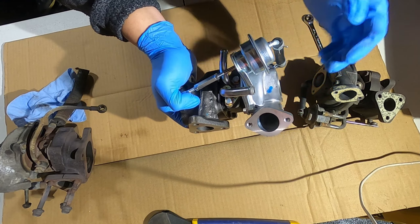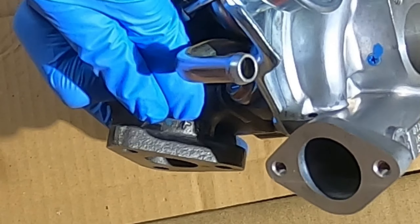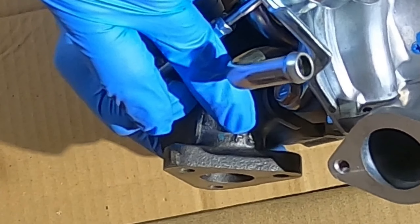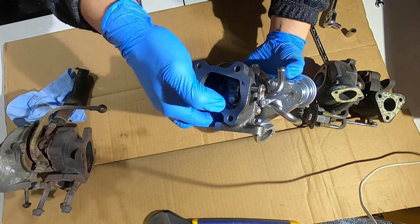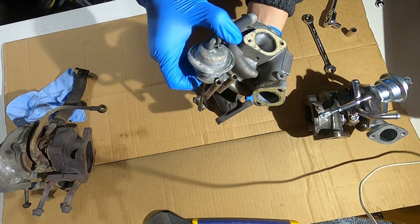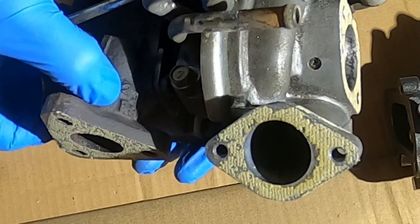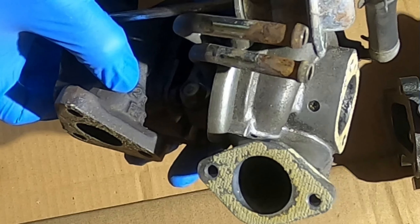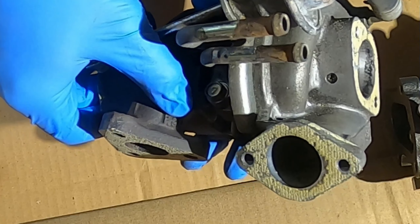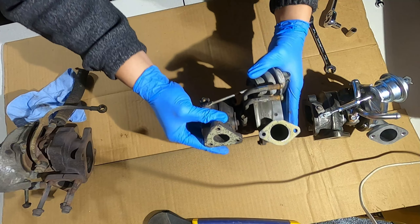How do you figure out the AR rating of your turbo? For IHI turbos, you can find a casting right here. This one says F9R — the 9 seems to signify the AR rating. On the VZ25 from the AutoZam AZ1 or Suzuki Alto Works, it also says F9R. There's another casting like '2J or something,' but the 9 on the bottom part signifies this is also an AR9 turbo.